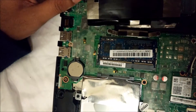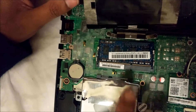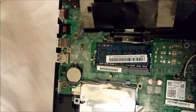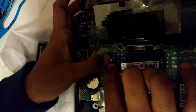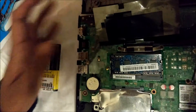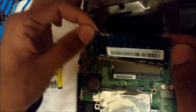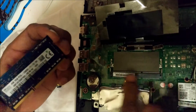Also check the series of the RAM — I will be showing you. Just turn it over and you will be able to see what series the RAM is. There are two clips that are keeping this RAM in place. Just move these clips and you will be able to remove the RAM. This is the RAM chip, and you can see this is the only one RAM slot available in this laptop.